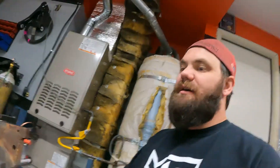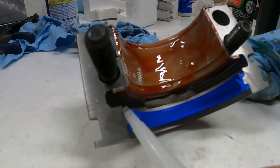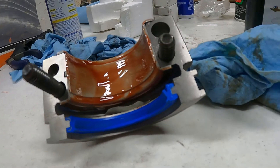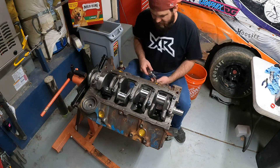The goal is just to get the RTV right in that spot — not going crazy or anything, just to help it seal. I think that's dependent on the seals you get — some seals need it, some don't. According to my instructions, my seals need it. Before you put the actual cap back on, you can also come to the cap side and put some RTV right here and right here and then set it on, rather than trying to do it next to the crank. There are so many little things you just forget.